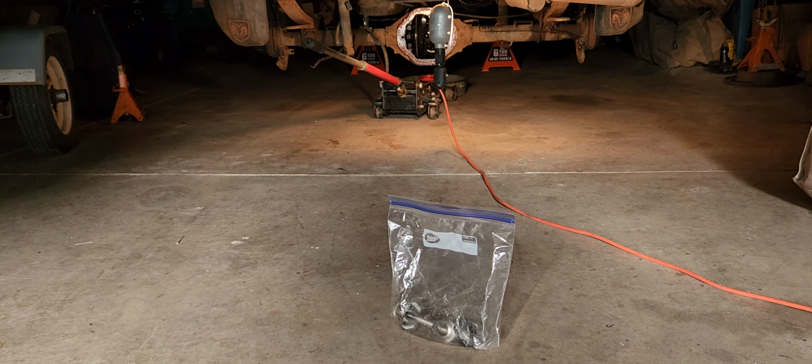I think I'm gonna need a new brake line. But other than that, so far, no real issues. It's been amazingly smooth. I just kept getting lucky about stuff. One thing that gave me a lot of trouble was unhooking, disconnecting the main brake line. I couldn't figure out how it comes apart because it was so rusty. Then I spotted the clip. I started banging on the clip with a screwdriver and a hammer, and it popped off. But then everything was still stuck. I couldn't get it apart.